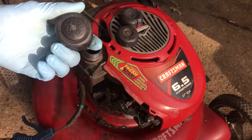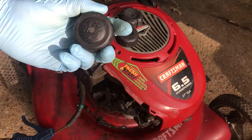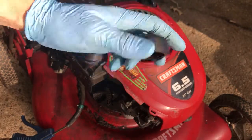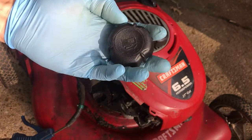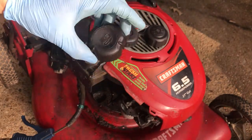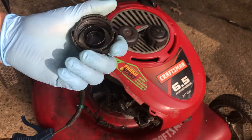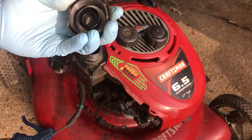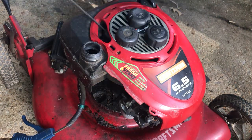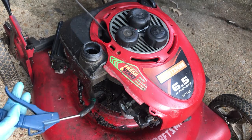Kind of the same result — didn't drain well. I don't know what this other cap goes to. I had another one that I found and I had better results. So I'm going to show you what I did to test it. You don't necessarily have to do it like this, but it could give you some insight into what's going on and how your tank vents — because if the tank doesn't breathe, the gas won't come out to the carburetor. So I've got air in the fuel line.